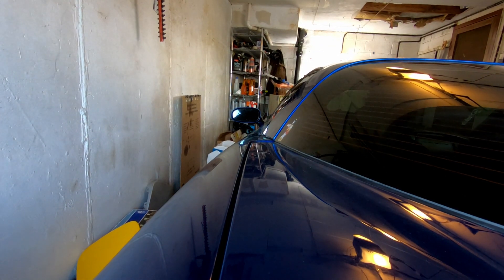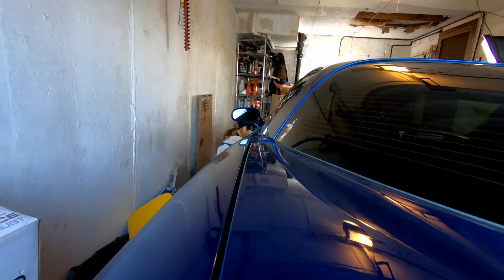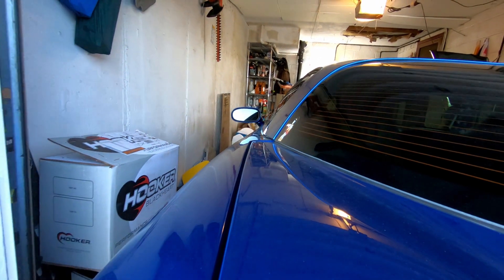The sun is going down, but let's give a quick spin in the car and make sure the pressure holds — most importantly, that the gauge on the inside is matching the analog gauge in the engine bay. It's off by about one or two psi, but that's to be expected. As I take the car around the block to let the engine warm up and double-check everything is working as it should, there are a few more things I want to say.